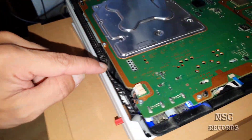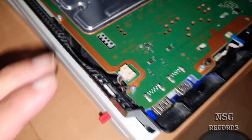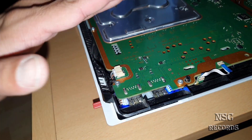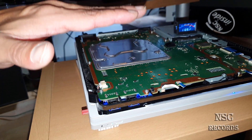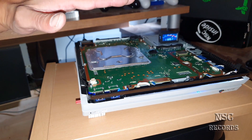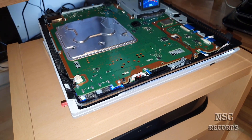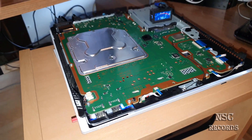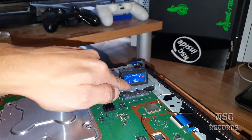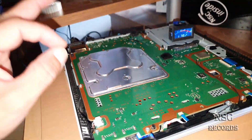The other thing I have tested - you have this small space where you can see the fan turning and some air comes out. I can feel it with my hand. I can feel the air coming out here, and when I go down I can feel it even more. The thing I have done with lots of tests - I really wanted to get the PlayStation under 75 degrees so that the fan will not turn higher.